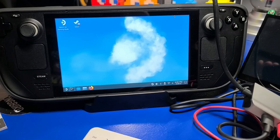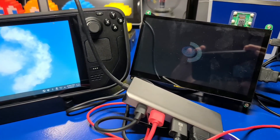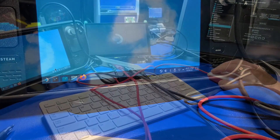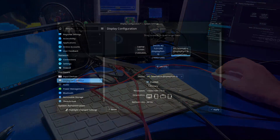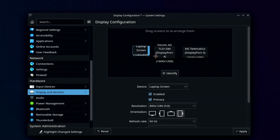You may be thinking that we didn't demonstrate the second HDMI port connected, nor the microSD slot on the dock — and that's true, I saved that for last. If you overlook my lack of cable management skills, you'll notice there are two external displays connected to the Steam Deck, which makes using the Steam Deck as a desktop PC pretty exciting. Click the System Settings icon on the taskbar. From there you'll find an option under Hardware for Display and Monitor. Clicking the Identify button will make it easier to rearrange the displays. You can drag and drop the displays according to how you have them arranged, change their orientation and resolution. Make sure the Enabled checkmark is checked — if you don't see a video signal, check this option and you should see the video appear.